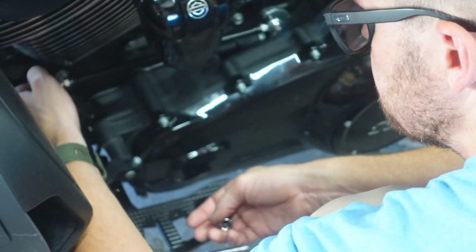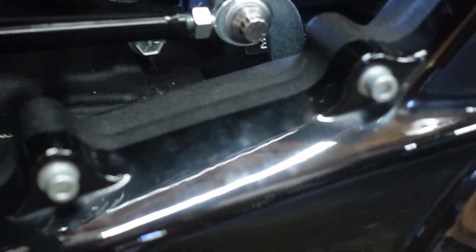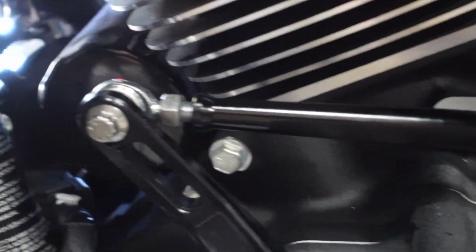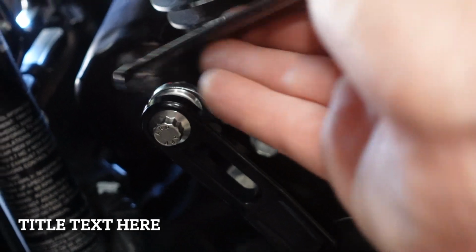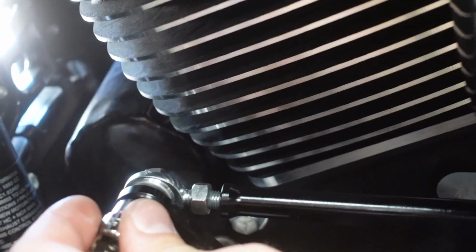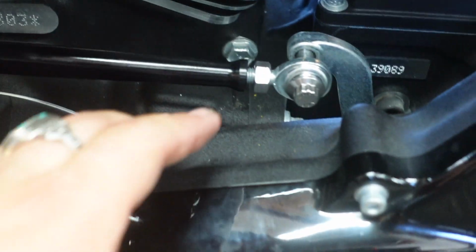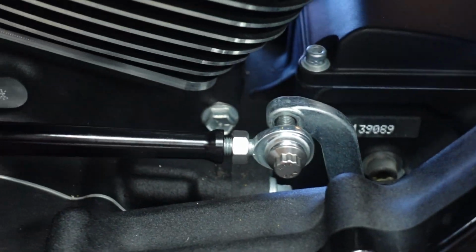Sounds good. And what size is the box wrench? The box wrench, let's check. I don't think it's still gonna be 7/16. Oh, it's half inch. So half inch box wrench on the back side. Yep, ARP is 7/16. So ARP in the back and the front, both the same size, with half inch box wrench in the back here. And that's how you're gonna tighten the two in the front, and then the back one's just threaded, so you just throw it straight in.